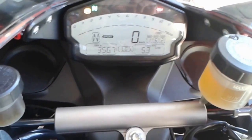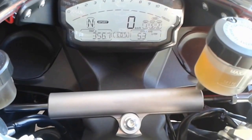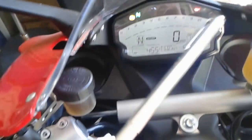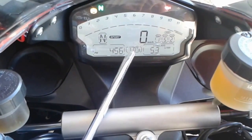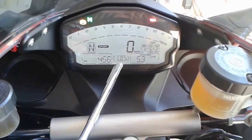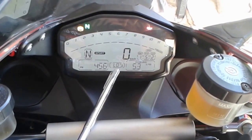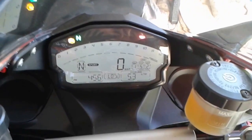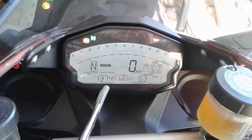So that's the current time there in the bottom left corner — 4:55, it's getting late. In the middle here we have the temperature reading. It's on 'low' because the motorcycle's not turned on. It will still read low until there's about 40 degrees, then you'll get an accurate reading. If it's on low, obviously don't ride off because it's not warmed up yet and you could be doing damage to your engine. Looking at the left box, that's my total odometer reading — 1,300 Ks at this point.